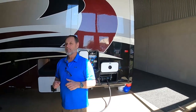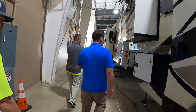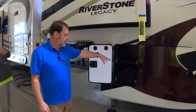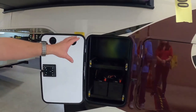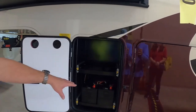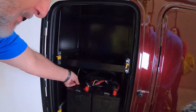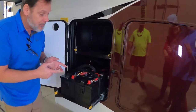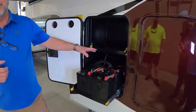How many lithium batteries could you upgrade? It depends on how much storage you want to give up and keeping the balance right. We do two trays here — you can put four batteries: four 6-volt or two or four 12-volt, whatever way you want to do it. What's really nice is both trays slide out, making checking and filling the reservoirs so much easier. And that is standard.